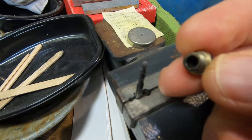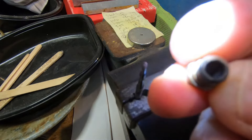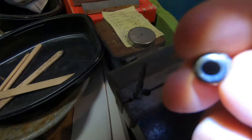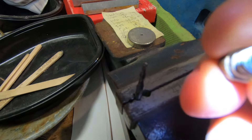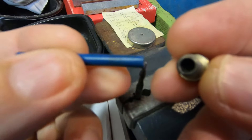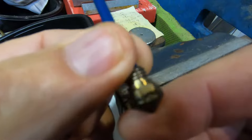Let's check our flashlight again. It's probably a little hard to see, but at the very bottom of the nozzle there you can see a little bit of silver, so it's pretty clean. What we'll do now is get our new heatbreak tube, put this in the machine, give it a try, and see how it extrudes.